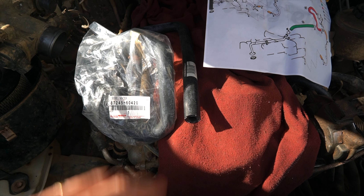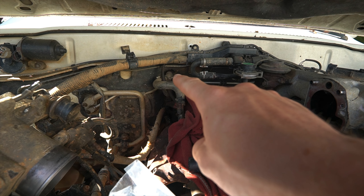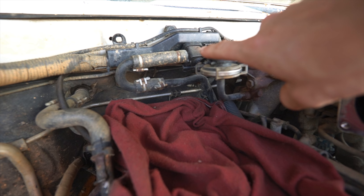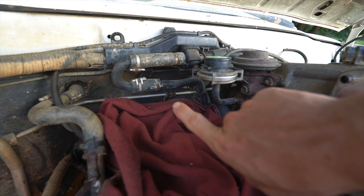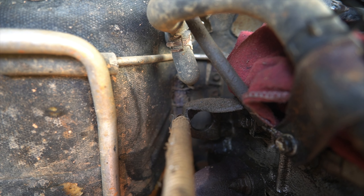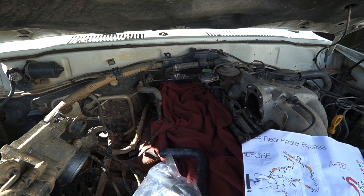Our other bypass goes from the heater valve — which I'm replacing with the OEM part — straight to the firewall. Typically from the factory it goes down through metal lines; you can see that really crusty-looking line back there, that's one of the metal lines that ends up rusting out. That's the whole reason people do this bypass, because it ends up being a bad coolant leak. It'll be a whole lot easier to do while the valve cover is off.